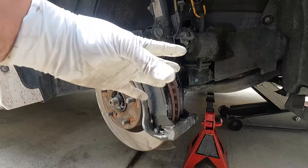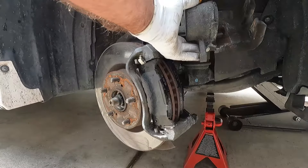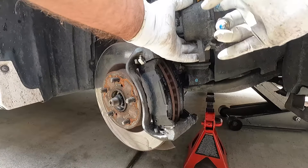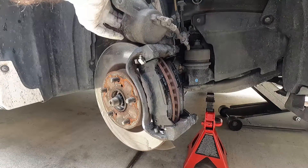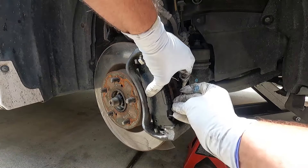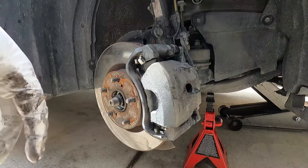When we put on these little V-springs, they're going to want to push the pads apart, so you need one hand free to squeeze them together while you get the caliper down. I'm going to unhook the caliper first to clean it up — just brushing off the dust, dirt, and debris. I'm going to hit the outside edges and the face of the caliper with some of this brake grease to cut down on noise and vibration and help prevent corrosion. Make sure that boot is still in good shape. Now while squeezing the pads together, get the V-springs on, then carefully put the caliper back over the pads. Make sure when you put the caliper back on that you don't twist the brake line — I've seen people do that before and then their brakes act up.